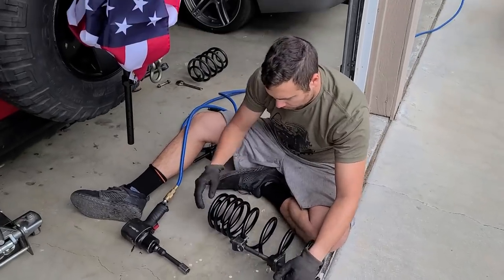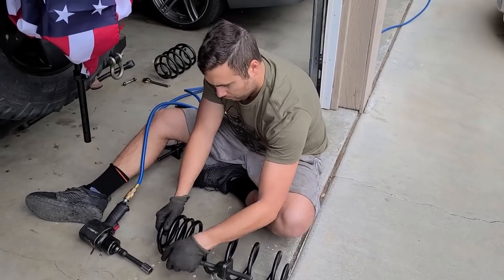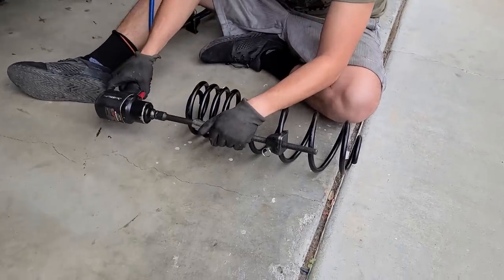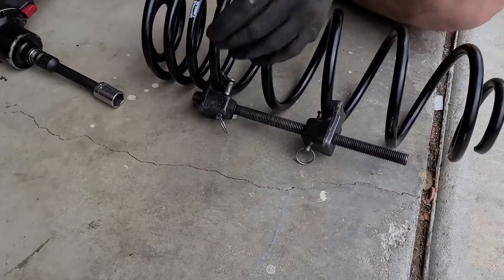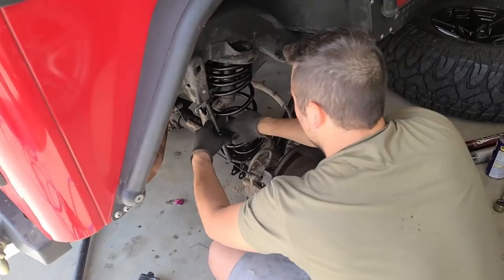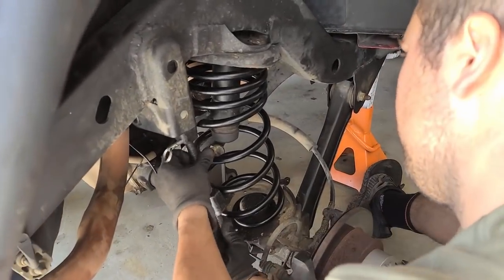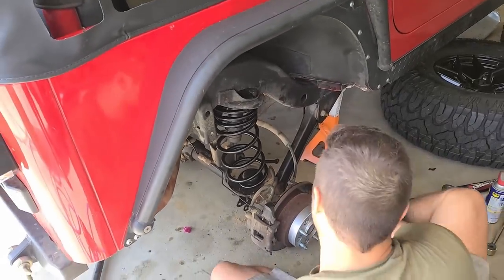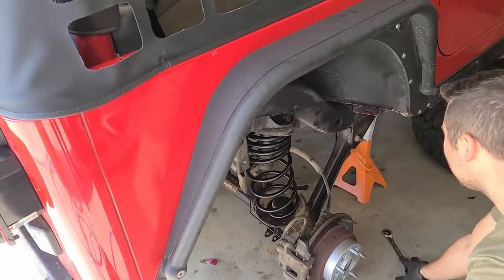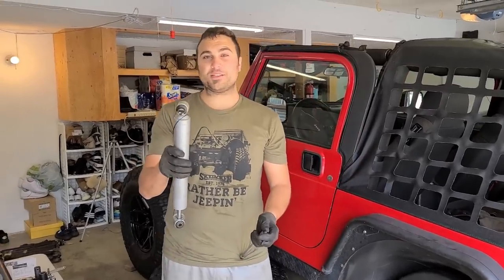Step one, put those clamps on so we can compress the spring. Something to take note of if you're ever using these clamps is those corner pieces do tend to get stuck. So make sure that where you're putting them, there is clearance for you to reach them. One clamp off, one more to go, just about out. Oh yeah. Now I know it looks a little bit funny, it's because the car is tilted the way it is. Both of the springs are in, everyone.